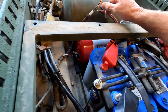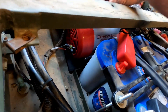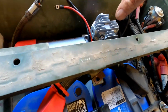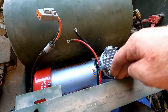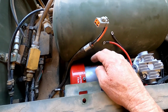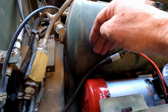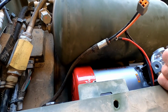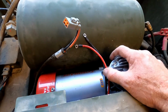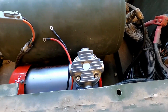All right, so I've got the compressor in. I have it bolted down. I have some time-lapse footage that I'm sure you guys just got done watching, showing us fighting that quite a bit. I ended up using two 5/16 bolts, one on this end here, the compressor, both those mounts have 5/16, and I ended up going to 1/4" bolts on this side, just because I didn't do a very good job trimming this rubber mat. It was a little fat, and it was pushing up against the legs of this tank. And instead of pulling everything back out, I just went to a smaller bolt, which is fine because the old compressor only had 1/4" bolts. I used washers on the bottom and also nylocks on the bottom, you know, locking nuts.